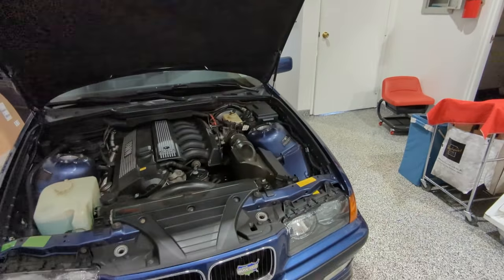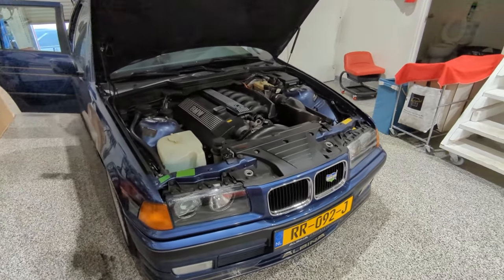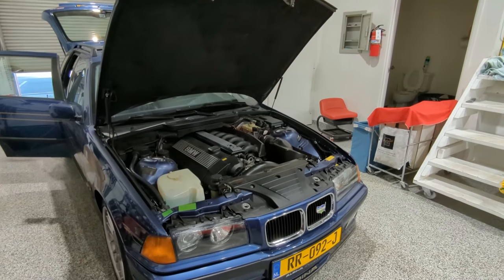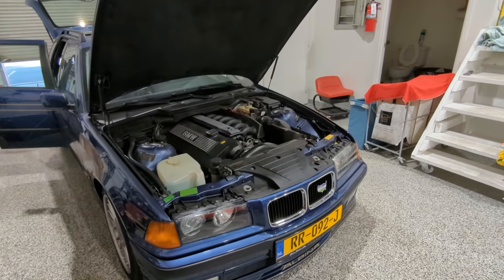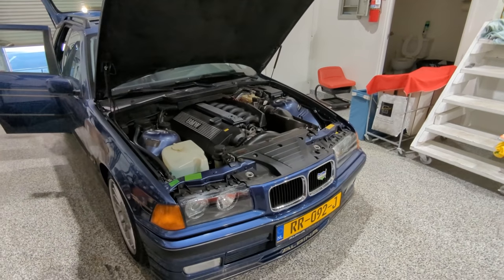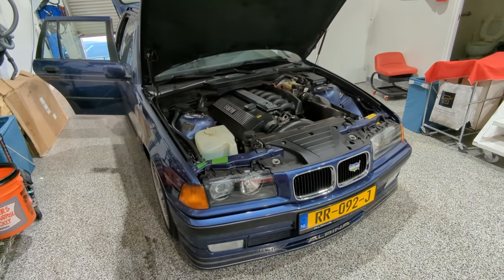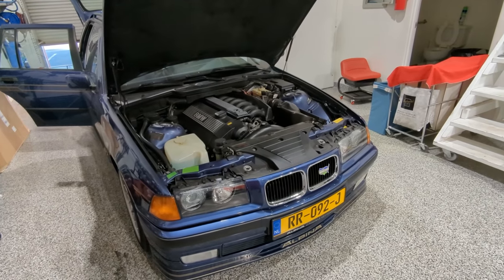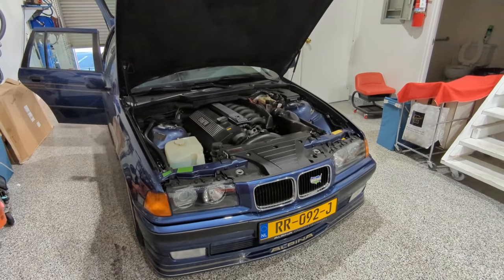So I'm pretty sure it's the flexible ribbon cables inside the ABS pump that are going bad, after some reading on the forums. The repair for that is taking the pump out, opening up the electronics, and then resoldering wires to replace the flexible cable. That's one of the things I do want to sort out, since I do drive this car sometimes as a daily driver.